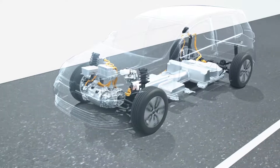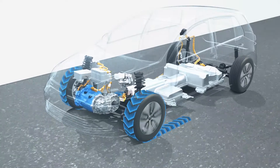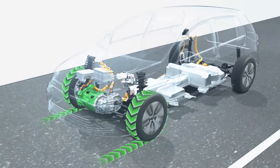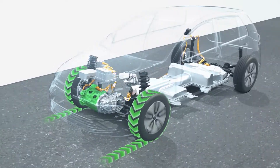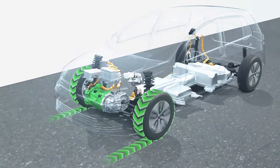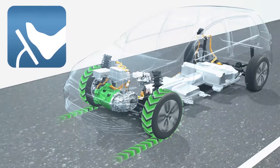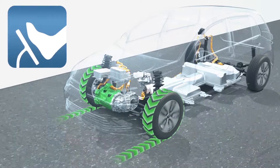As a simple notion, the motor that drives the car and moves you forward, when you're slowing down, spins in reverse. That helps slow the car down but it also captures energy. It's able to work in the opposite direction — rather than taking energy out of the battery to move you, it's able to send electricity back into the battery to charge it up. Now in reality it's not quite as simple, but that gives us a good grounding to start from.